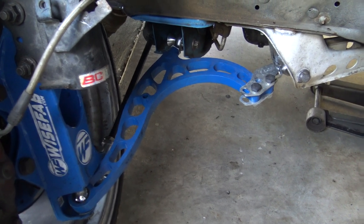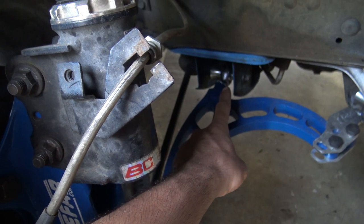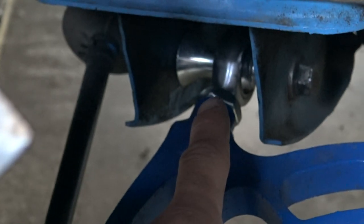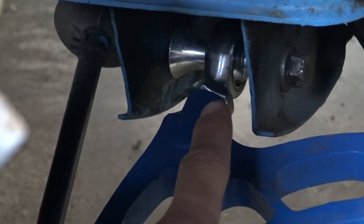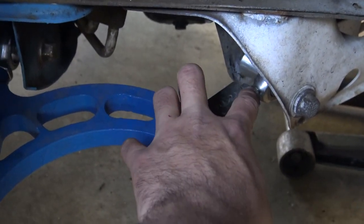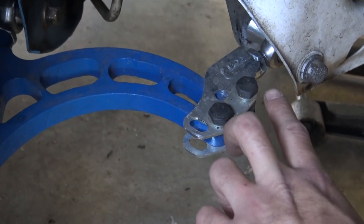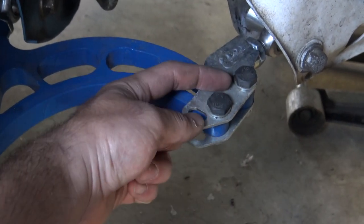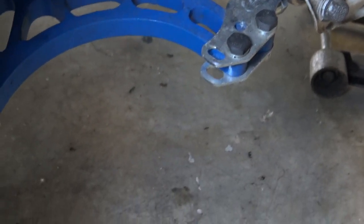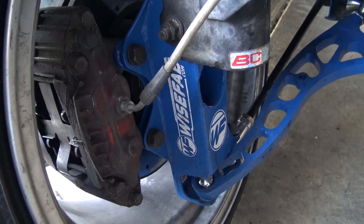So coming underneath the car, you have the lower control arm point. I did not change the adjustment on it with that lock nut. Didn't change anything. The manual said to just install it as it is. Up front for your caster arms, it also said don't touch that, so that is installed how it came. You put the bolts here for an S13, or you put the bolts here for a 14. There's the knuckle.